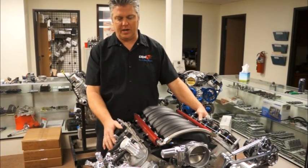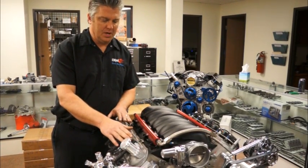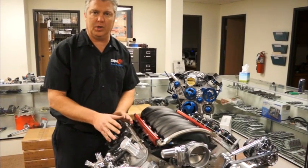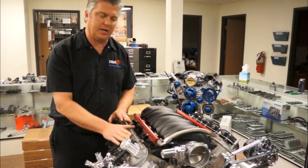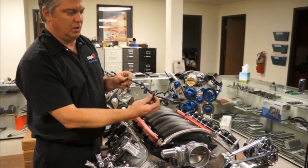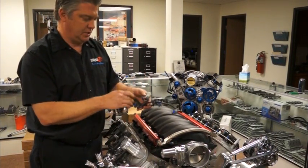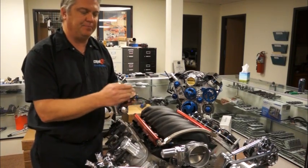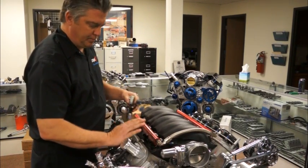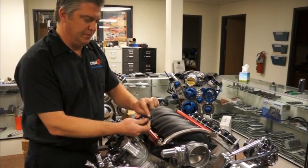I'm going to go through a brief description on how to install the coil harness, because I see this happen a lot. People will get different brackets and different coils and the coil harness becomes a question. Basically, what we're going to do here is we have a general coil harness. They may have a little different connector depending on the coil you have, but all of the colors are going to be the same for every coil setup. The main thing you want to look for is when you put the connector on the right coil, you're going to want to have the pink, red, black, and black wire.